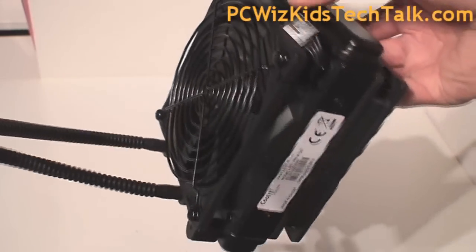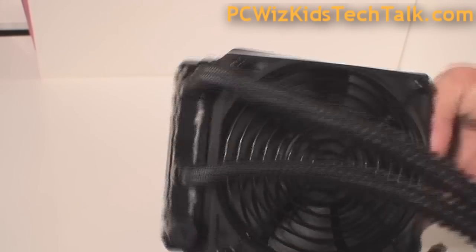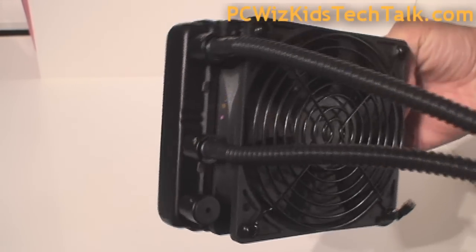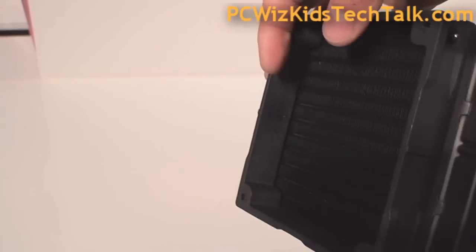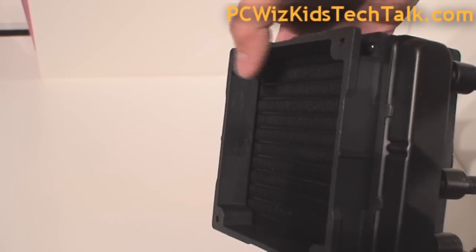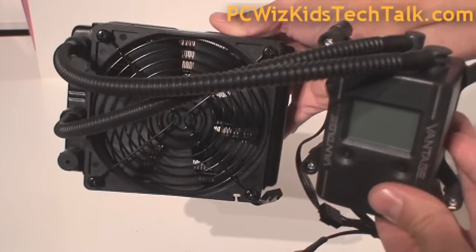It's been proven and tested. The other side of this radiator has no fan, so basically you've got air that is blowing out of the case — that's the way this one is set up, to blow out. You could install another fan and have it sandwiched around the radiator — one fan on this side and one on the other — so you've got a push-pull effect to blow the air quicker out of the case, keeping things cooler overall.